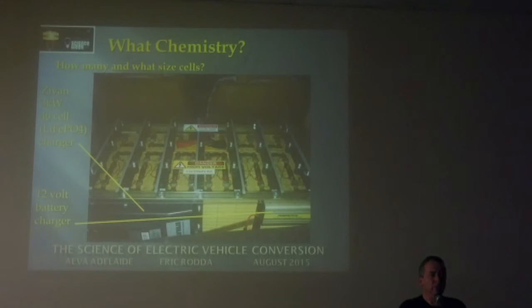You've got to have a charger that will do that. You can't have anything that needs you to push a switch at the same time to start it. It's got to be self-starting. But it seems to work well. With my two cars now being plugged in, I've got a timer set up so that one car gets charged, and when the timer gets to 3 hours, the relay changes over to the other car. So I can charge the electric car and the Prius all on the same night. It's not all wired up yet. At the moment, if I want to do both cars, I do one on J tariff and one on normal tariff.